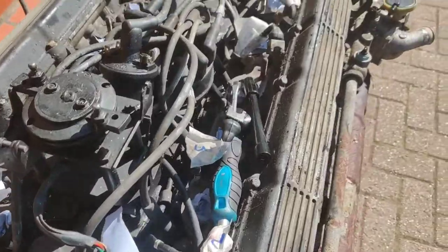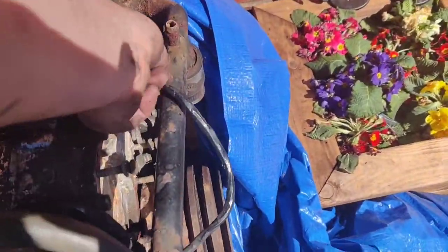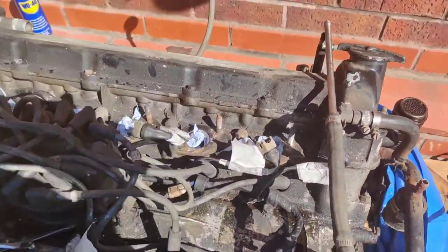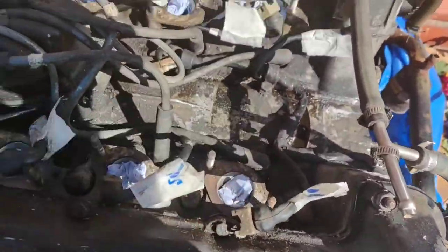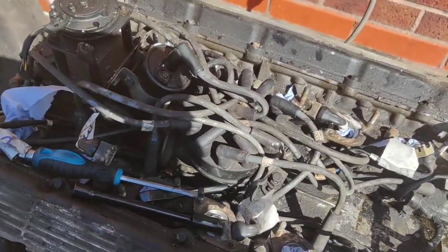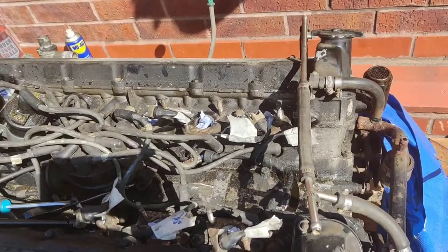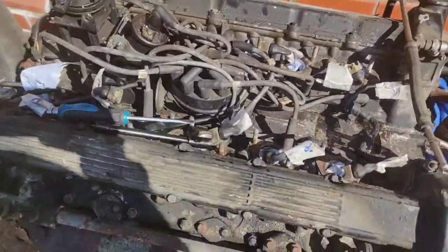Now what I'll do is probably take off this sub loom, because I'll move that loom there. That little sub loom is the fuel injectors. Sorry, not the fuel injectors, the fuel injector plugs. So if I take that off, it'll clean it off. Then I can get rid of the HT leads, get them out the way. And then all this is nice and clean and can be cleaned and scrubbed and hoovered and made to look sexy again. So that once it goes back, hello princess. Once it goes back, it's all...